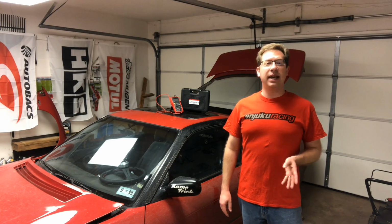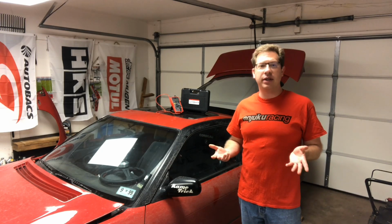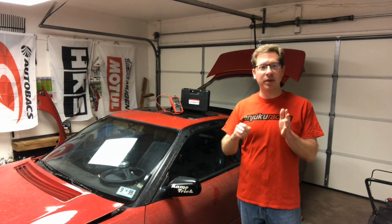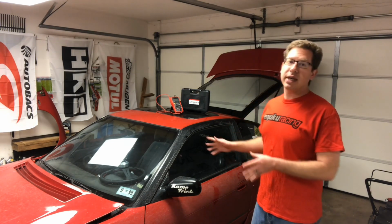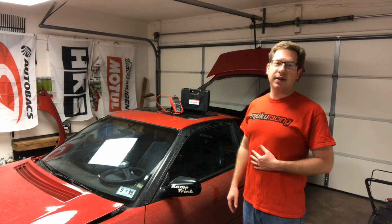So if you watched my last video, you'll know I just fixed an alternator problem where it's pretty strange. I've never seen this before, but the charge post on the back apparently threads in and it came loose and it quit charging. So as soon as I got that fixed, I knew it was low on gas, so I put about 2 gallons in it and it started running great.